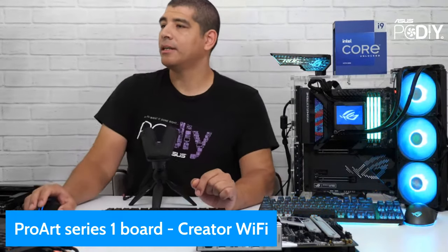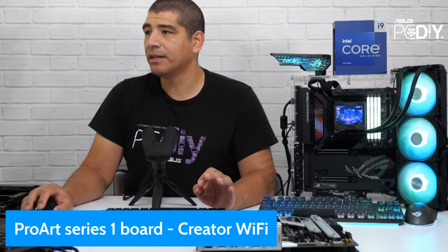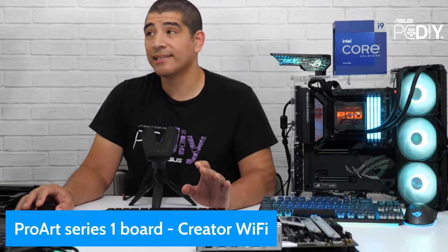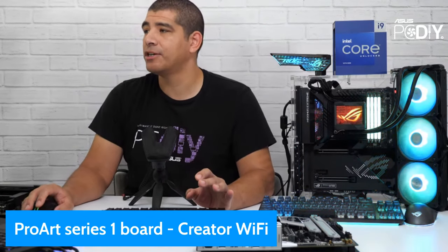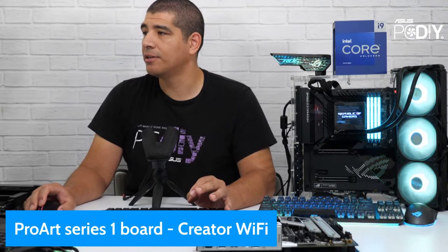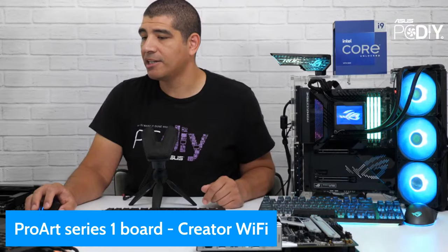Okay. Let me go ahead and go over to the physical tour of the motherboard. And I don't think I talked about the power stage configuration on this one. This one is a 16+1 power stage configuration. So it is a very high performance power stage configuration that's in this board. 16+1, 70 amp power stages, and these are all SPS based power stages.